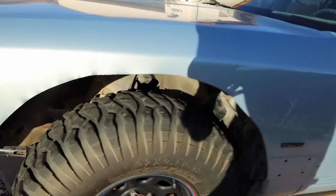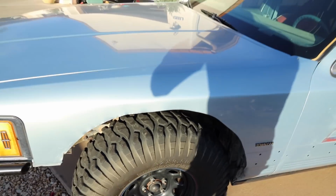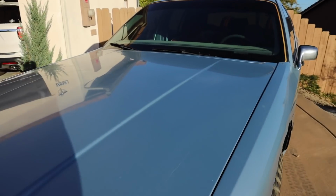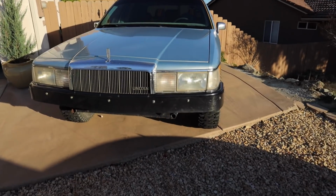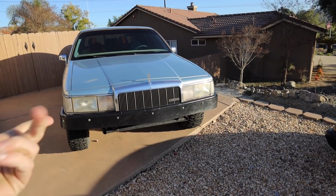It's only about a 3-hour drive for me, so it's not horrible, but this thing has absolutely blown out shocks. I actually inserted a video from last desert trip. This thing floats, but the shocks are pretty, like, it needs shocks. It also could use some ball joints, which I'll pop the wheel off and show you guys. The upper ball joints are pretty much destroyed. So I have some new ball joints here. Shocks are on order, so we'll have shocks front and rear. And it should be decently prepped enough to go off-road in the dirt.